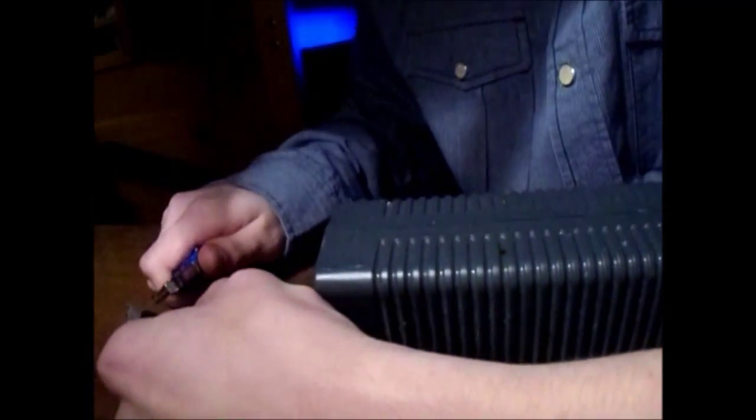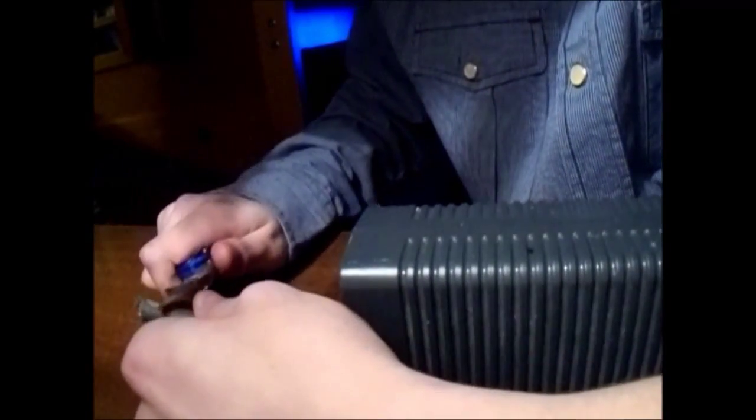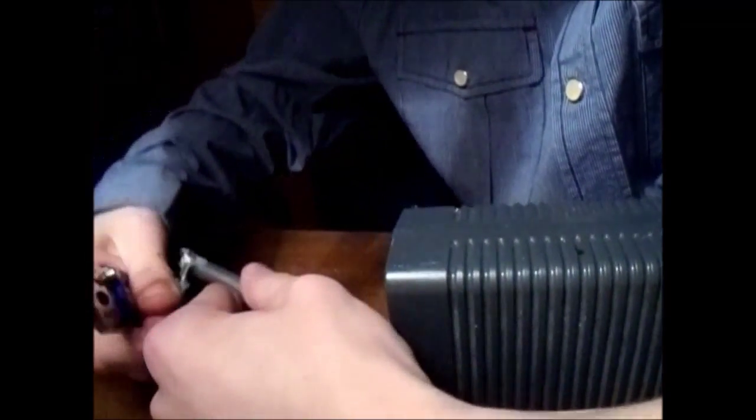I got lucky and the rubber split. Basically, you just want that rubber off — you don't want to cut through to where the wires are, because you're going to need to twist them together. You just want to remove the things that are covering them. Next, take your other power supply — the Xbox 360 Slim power supply — line them up, and figure out how much wire you're going to use by marking it with a sharpie or pen.